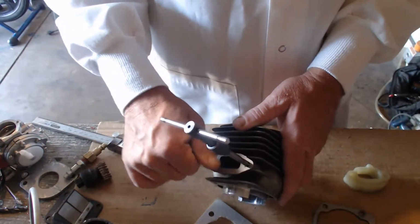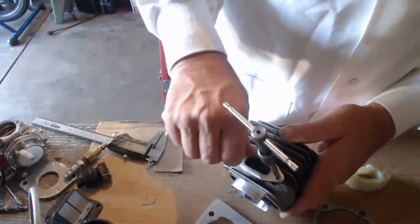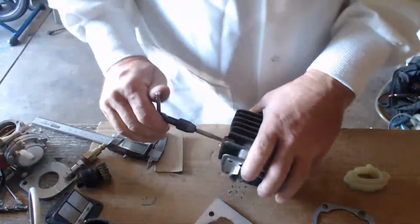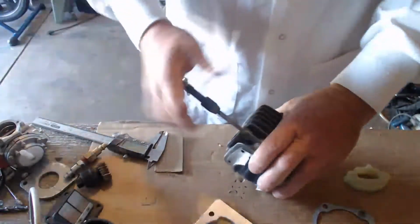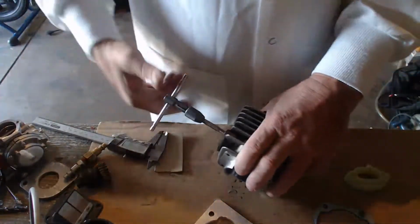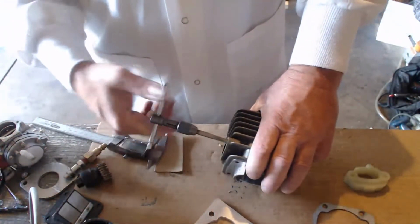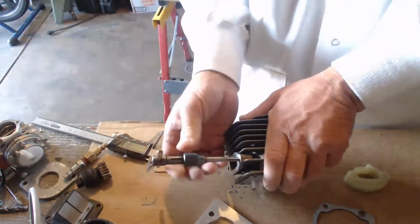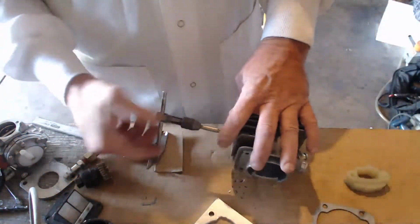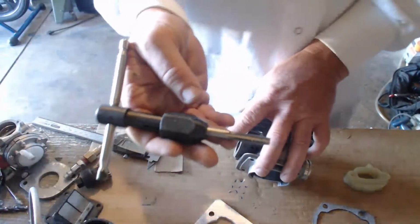I'm making sure that's a 6 first. Yep, that's a 6. 6 is fine. I like that it's a 6. Tapping it makes tapping out the quarters real easy. Everybody's all like, I have a stripped M6 head. What should I do, Brad? Tap out. M6 to tap out to a quarter or 5/16. First tap it to quarter, and then if the quarter doesn't seat, not biting into any threads, then tap it to 5/16.